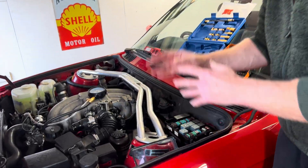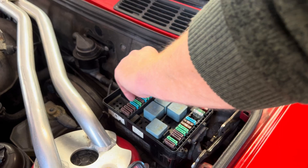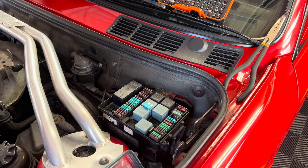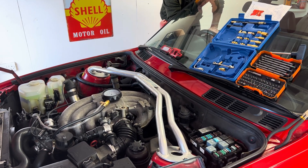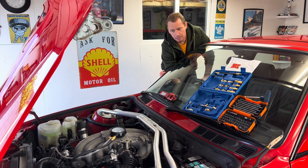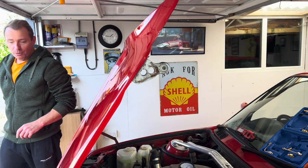When it comes to disconnecting everything, you don't want to spray fuel everywhere since the system is pressurized. You can either press this button here and drain the fuel into a cup and put it back in the tank, or you can remove fuse 11 — that's your fuel pump fuse. If you crank the engine it will start and then stall because there's no fuel pump running. You can see the fuel pressure has dropped and now about 90% of the fuel in the fuel rail is gone.